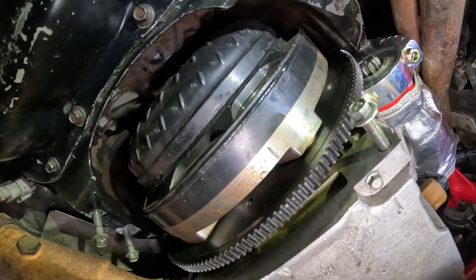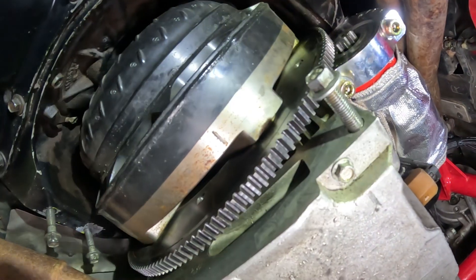I'm going to put our dust cover back on and get the car lower to the ground. So it's been a few days now. I've got about 100 miles on the car and several starts — cold and hot. I did have to remove the shim, so I have no shim now. It's just straight starter onto the engine block, torqued according to MSD's specifications, which I think was 32 foot-pounds. Either way, check your instructions. So that is great now.